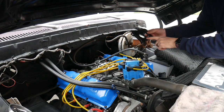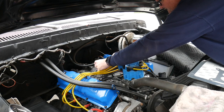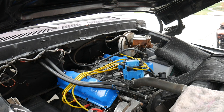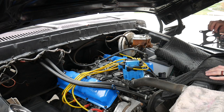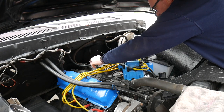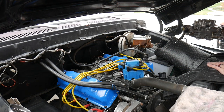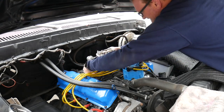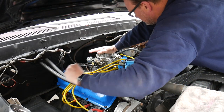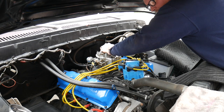Mounting. I've got gasket, spacer, and another gasket before the carburetor itself goes on. Oh my gosh, this is gonna be awesome. Can't wait to drive this thing. Alright. Carburetor. Gasket. And now carburetor itself. Let's go. Alright. Let's see if we can get a nut started. That spaced the thing way up in the sky. Well, if I have leaks, I know where it's at.